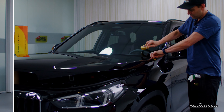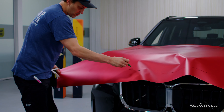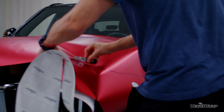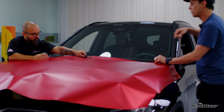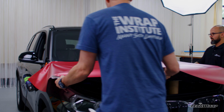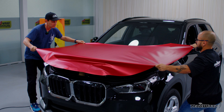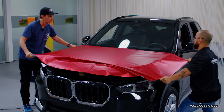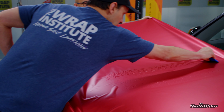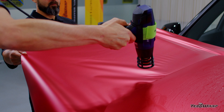Begin with the hood install. It's highly recommended to prop it up and place masking tape on the upper corners for a strong corner game. Mark the excess material cutting-off point and then safely remove it to make the install easier. It's always a good idea to work with two installers on the hood. Release the liner underneath the hood — the medium initial tack will help with the install so it won't tack too hard. Pull evenly across the top, and to avoid scratches use a low-tack solution — Triple S — to help the squeegee slide and glide.